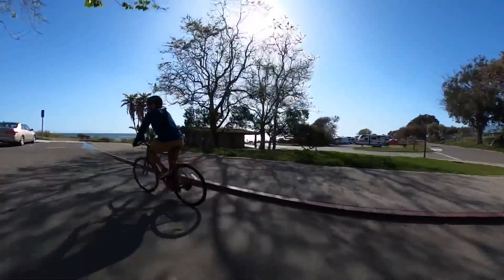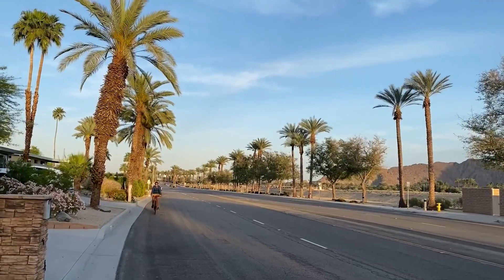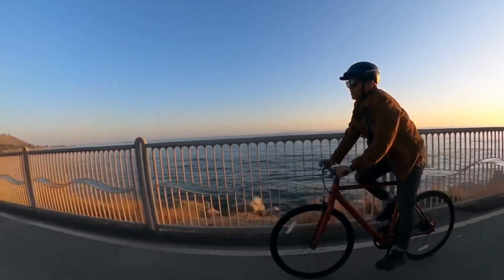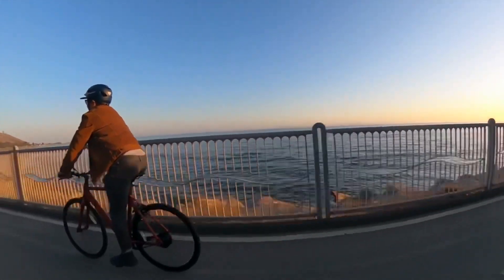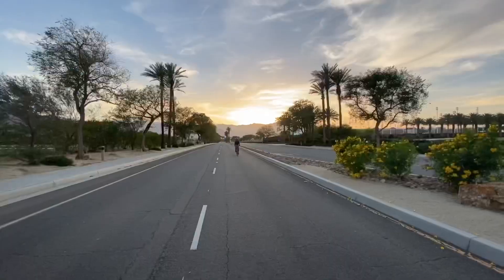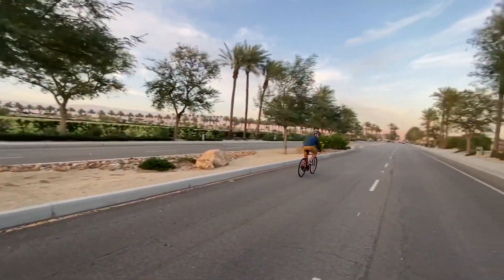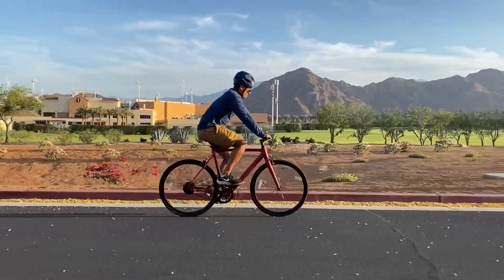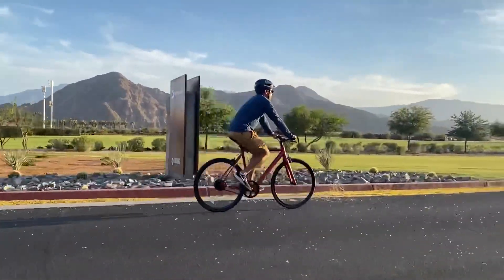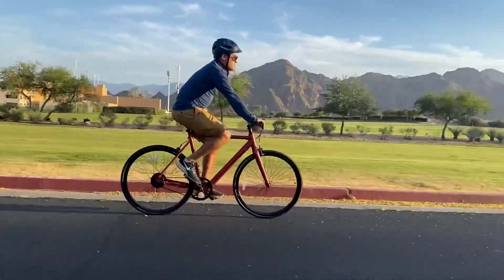It's true there are other Class 3 e-bikes that go 28 miles per hour, but honestly you don't actually get many opportunities to ride 28 miles per hour on public roads, so in my opinion 25 miles per hour is plenty fast for an e-bike. One of the most unique features of this bike is its belt drive and rear hub Shimano motor, which delivers 350 continuous watts and 500 watts of peak power. You usually don't see belt drives at this price range, and the force you exert through pedaling is more directly translated into the motion of the wheels. Belts are just inherently more efficient than chains, and the 40 Nm of torque this motor delivers makes this an extremely responsive bike that is very enjoyable to pedal.